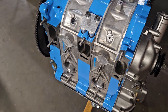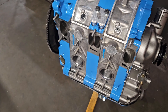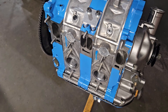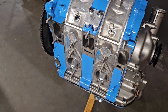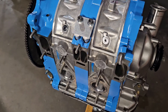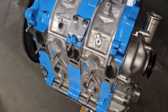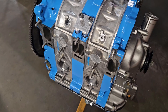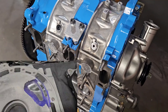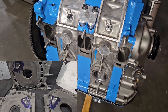But when you're going into the traditional road racing — giant bridge, J bridge, GT-style bridge — a lot of those concerns go away. With a very open exhaust and very open intake, you're able to actually have advantages in those duration and intake overlap areas where you do get some scavenge. That can actually help with flow and horsepower — rotaries don't mind it in the naturally aspirated application. The modern renaissance did away with almost all of that, largely due to emissions. But in the traditional sense of Mazda rotary road racing, making horsepower was the concern, and that was done with this aggressive style intake porting.